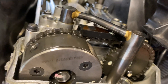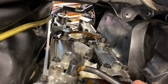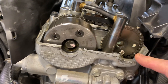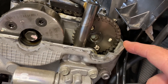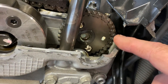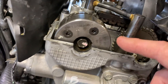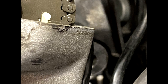One tiny correction — I'm actually going to put it on top dead center for number four here. If I have it on number one cylinder, these two marks are pointing at each other, and that makes it impossible to line up the timing marks with the actual cylinder head surface, which is what you're supposed to do. I'm certain they want you at number four top dead center because that dot lines up right over there. You definitely want it on number four top dead center with these marks opposite each other, and with the one-and-four mark lined up on the crank. Glad I caught that.